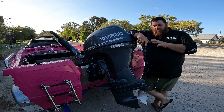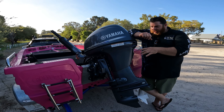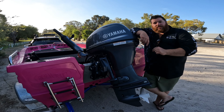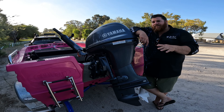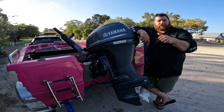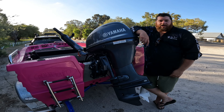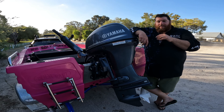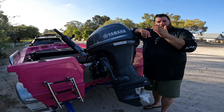When you first get your outboard and drop it on the transom, a lot of the time it's sitting way too low. You want the cavitation plate level with the bottom of your boat. With a Yamaha, I generally find about 25mm is optimum. If you've got a trim tilt on the tiller or control panel, up a smidgen more is perfect — you can raise it slightly above the bottom of the transom, but level with the bottom of the V is ideal.